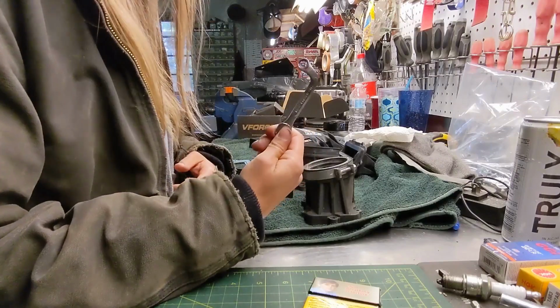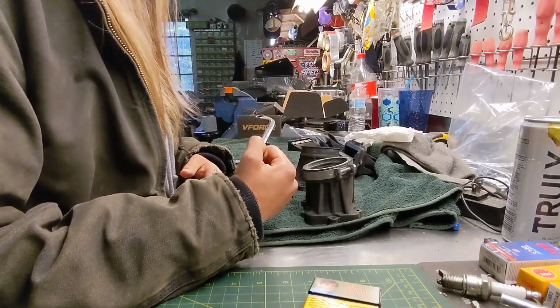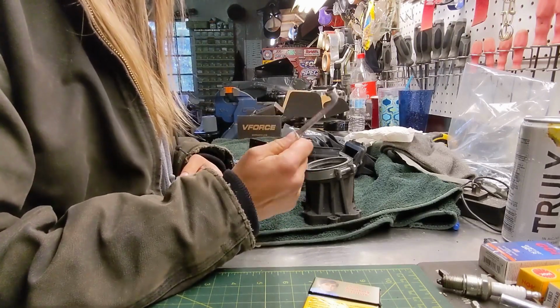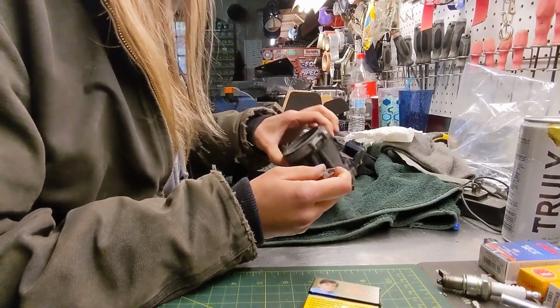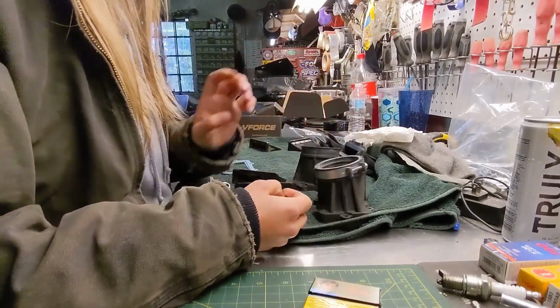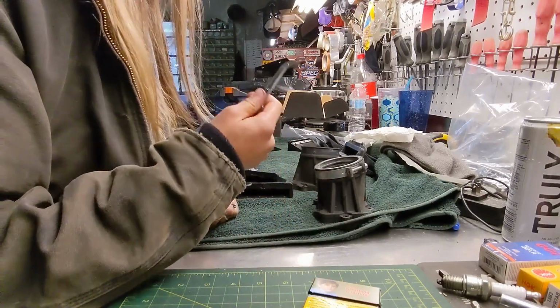You're gonna need a special tool. There's no way around it. You're not getting a wrench in, you're not getting a socket in. So unless you want to pull the entire secondary, get yourself a crappy little 8mm like this, heat it, bend it, and get the smallest one you can, because you're basically going like this over and over, moving it less than a quarter turn at a time. It's a struggle, it's frustrating, but sacrifice the wrench and it'll get done.